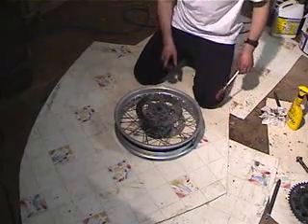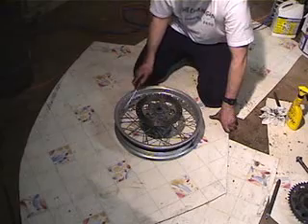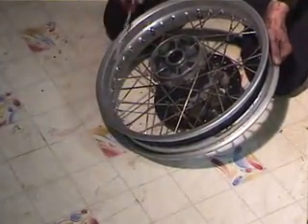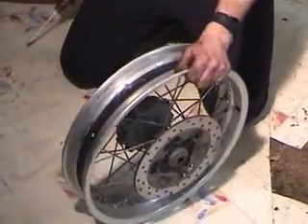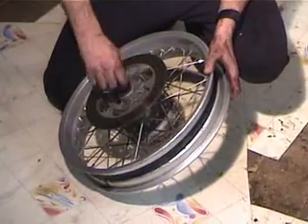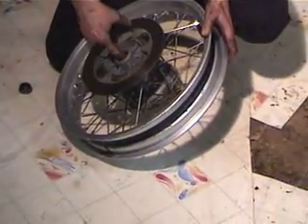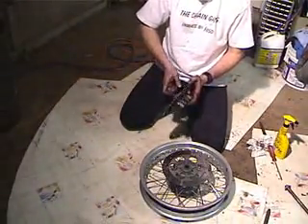What I'm going to do is bang on the spokes and make sure none of them need to be adjusted, because if they need to be adjusted, while you have the tire off is the best time. None of the spokes are dead. While we've got the wheel off, it's a good time to check the wheel bearings. You stick your finger in there — actually you remove the cup and stick your finger in there and you can feel the wheel bearing rotate. If it feels real grunchy it needs to be replaced. This guy feels pretty good, that guy feels really good. Do the carrier bearing as well — that feels fine.